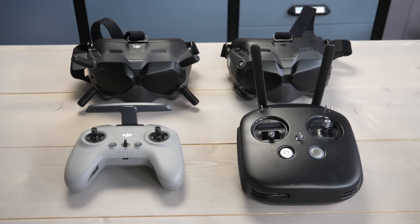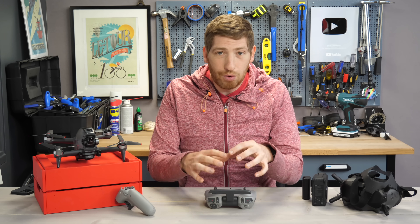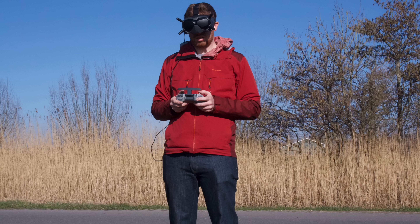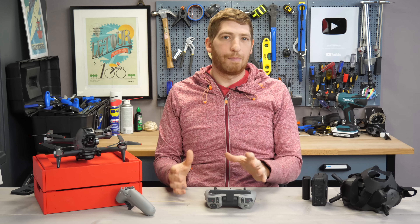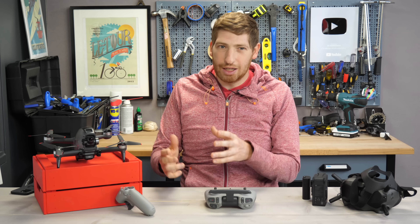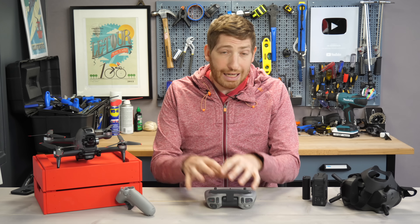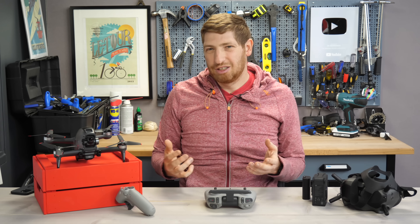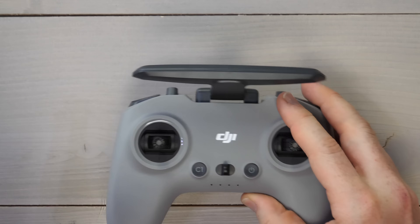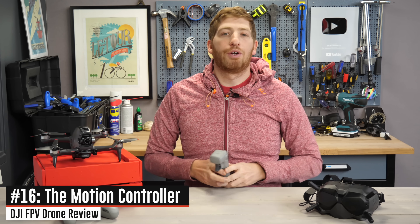On the flip side, this is the new DJI FPV remote. It's quite different from the original — much much smaller, with a T-bar at the top. What you won't notice is any phone holder, which will sound obvious to FPV people but not to newcomers. You solely use the goggles to control the drone. I think that's a bit of a lost opportunity — in many scenarios for legal reasons you may not have a spotter nearby, and being able to mount a phone and use it in a conventional setting would make more sense. You can connect a phone via the app, but there's no place to mount it so it's a bit awkward. You can open flaps on the controller to adjust the sensitivity and remove tension so it acts like a normal FPV controller.